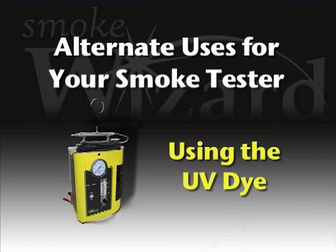So that's where the ultra trace UV dye comes in. Let's go ahead and put on our glasses, get our black light out and look at some of that ultra trace UV dye. As you can see here, the injector right where it enters the bottom of the lower intake is leaking vacuum. We've got a vacuum leak there, and you can also see what we were seeing really well with the smoke — the intake upper plenum leaking air as well. This thing is going to be running lean and compensating a lot in fuel trim. We just nailed this thing. The little black light, the right glasses, you can see a lot of things that maybe the normal eye can't. And that's the beauty of the dye. The dye that comes out with the smoke, even if it's a leak on the lower intake, when you take things apart you see the fingerprints — the evidence, if you will, of a leak.